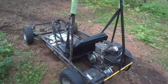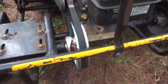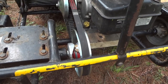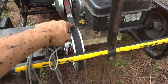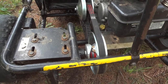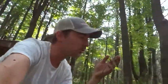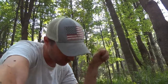Alright, got it together, been riding around, having to tweak a few things. The motor on the chunk of wood does move around a little bit, so that gets interesting. And you gotta get this belt just right, otherwise too tight and it tries to take off on you when you start it, and too loose you lose the power. But the other thing that's been slowing me down today is the pull cord. Broke the pull cord, fixed the pull cord, broke the pull cord, fixed the pull cord,